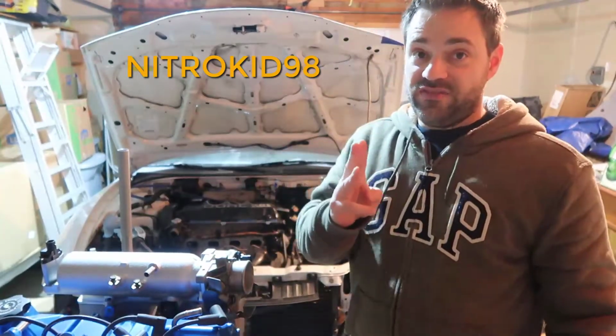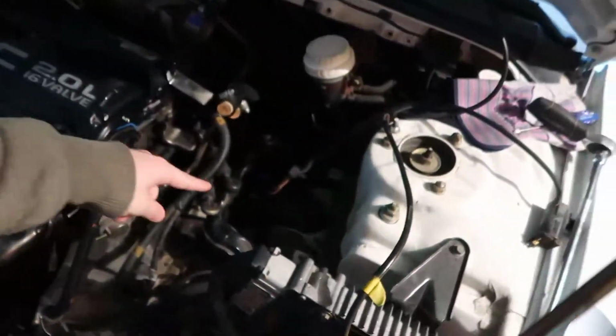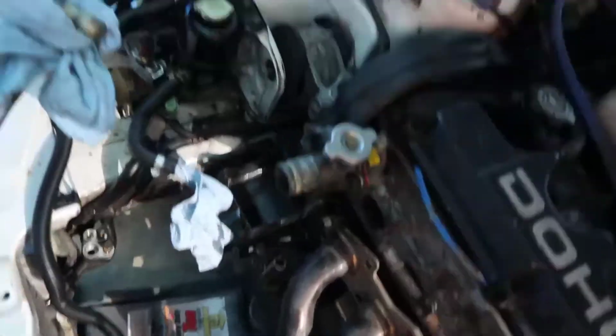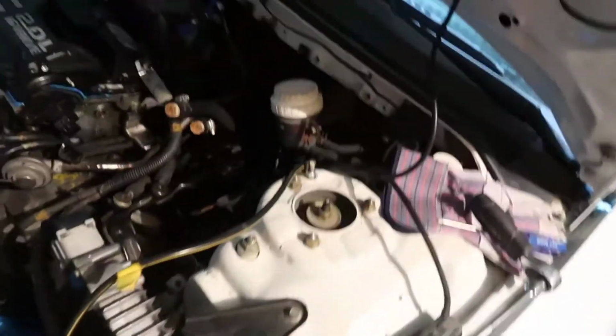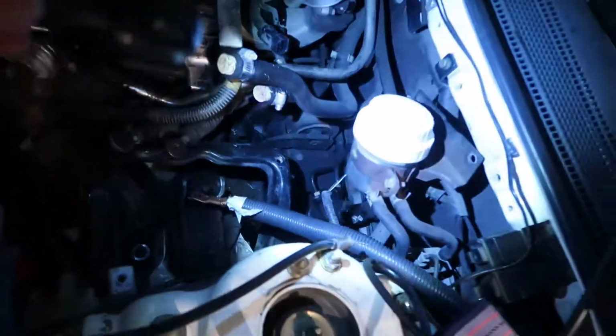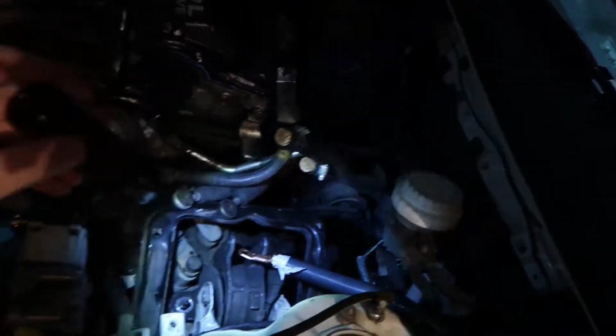As I've seen, he's done that in 3 steps. So let's take this engine out of there now. Okay, so first step would be to take the engine mounts, which has one in there, one in here under this bag. Can you see down there? And one in there, and one behind the engine, which is kind of hard to see, but is right there. That one I didn't mess with yet.